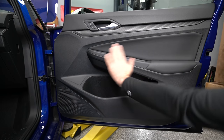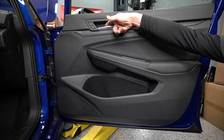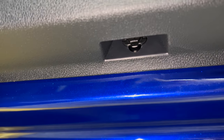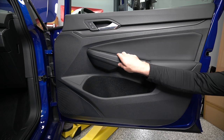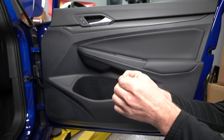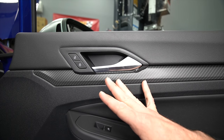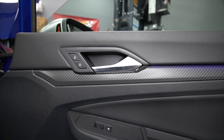When we look at our passenger side or driver side door panel, the fasteners are all in the same spot. You have one behind the door open handle, one behind the grab handle, and a quarter turn down at the bottom pretty much center on the door trim panel. Something I've noticed on Mark 8 is a lot of this plastic feels ultra soft, so masking tape it is — we want to be extra careful not to mark up our brand new car. I'm also gonna put a little masking tape on our pocket screwdriver to help protect our door panel. Before we take our door panel off, put our window down — this is gonna make taking the door panel off so much easier.